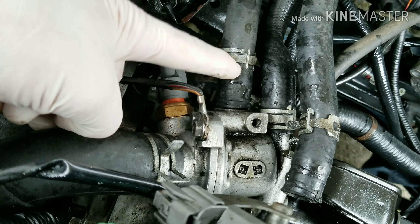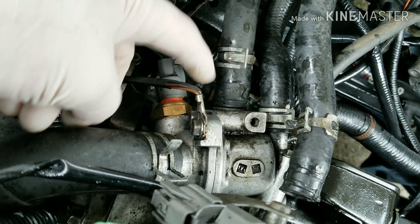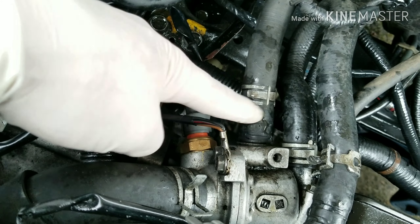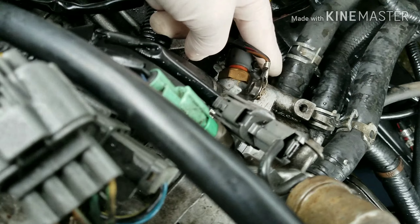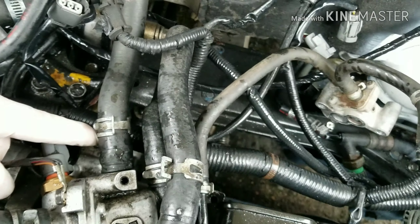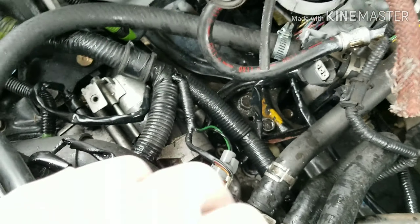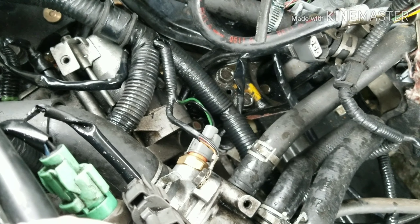As soon as I realized that the power steering was going, I looked over and saw that the heater hose coming from the firewall was shooting out coolant all over my sensor. I immediately released pressure - that caused it to stop - but this is torn. Metal plus rubber plus 20-some years equals a small tear. So I'm going to be replacing that. I haven't figured out if I'm going to drain the coolant yet or just try and go for it - I think I'm going to go for it.